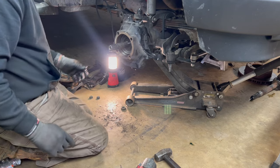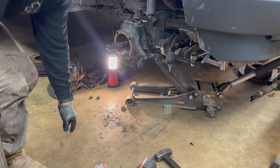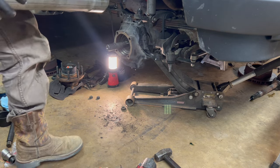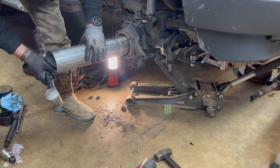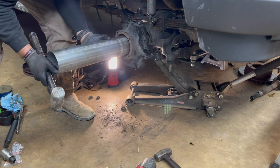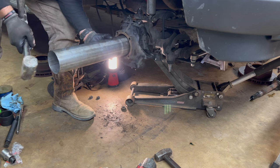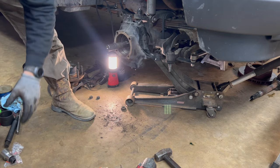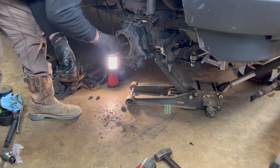Now you attach the seal in. There's actually a specialty tool for it that I don't have. Never had it. Put plenty together without it. A piece of 4-inch pipe with the flare. Not the regular 4-inch, but the flare makes it just right for going over that metal ring there. You just hold it. You're not going to beat on it, you just tap on it. In there. You don't have to get crazy with it. Make sure you're in your axle and nothing's gooped up about it.